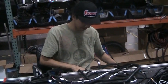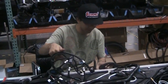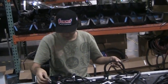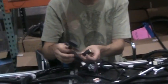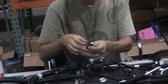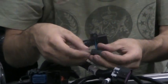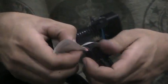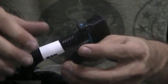You're also going to want to find the other Molex connectors — the two Molex connectors you have to do for this wiring harness. This one will have the ignition switch and the MIL wires. You basically cut those, put the MIL into slot one of the connector, and put the ignition switch — the pink one — into slot two. It's a three-prong female socket.